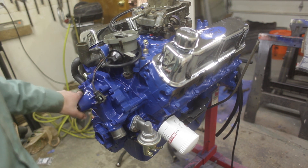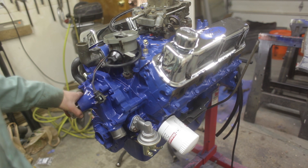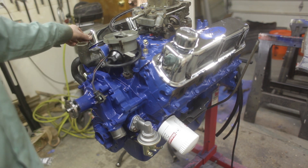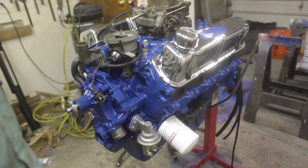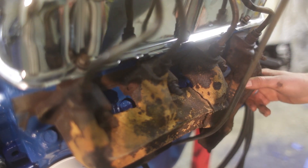A lot of the header kits don't really look like they guarantee fitment in the trucks, and I don't want to spend a bunch of money on something that won't even fit. So for now it's just gonna be weld up the old cast iron one to get it broken in at least, and then figure out something else later on. So the crack in question is this situation here.